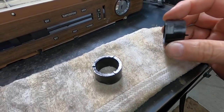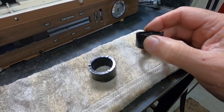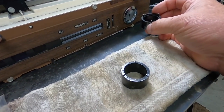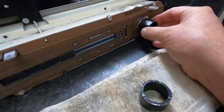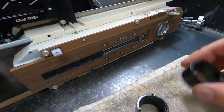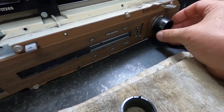These are a couple of ignition switch removal tools. This one does General Motors from the fifties and early sixties, and this is the Ford one. The GM one will work on it, but it just doesn't fit really well. You could conceivably use the GM socket on that, but this is the correct one for this ignition switch.